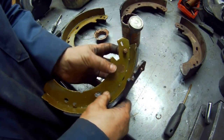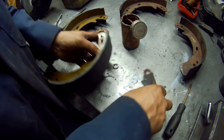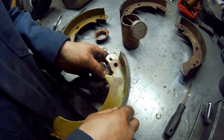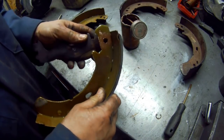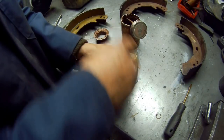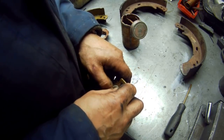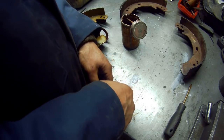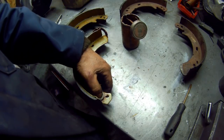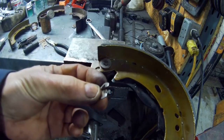So, pin through here. We're going to put some copper grease on these areas. Put the arm on, like that. There's plenty of grease on there. And then the two conical washers, the big washer, and this is where we have fun putting this little clip back on. This is going to be tight — I might get it on. No, I'm going to have to put this in the vice. I didn't realise how difficult putting this C-clip in would be.